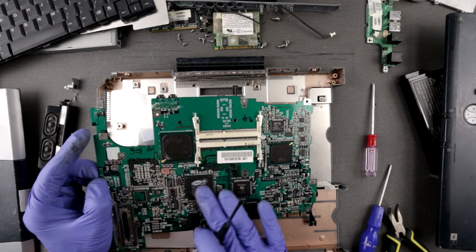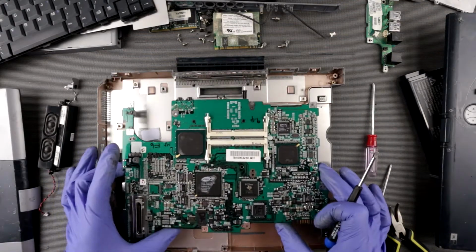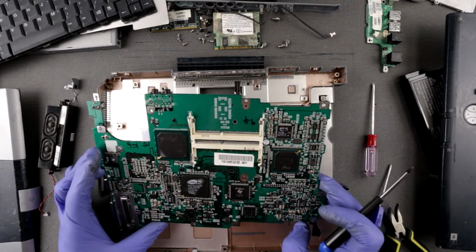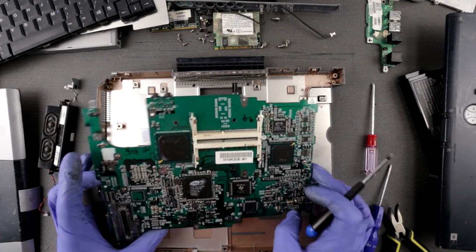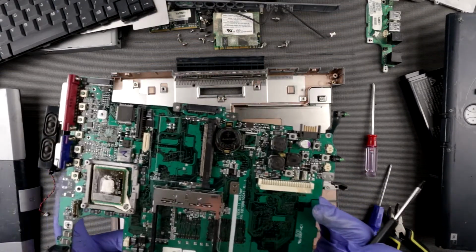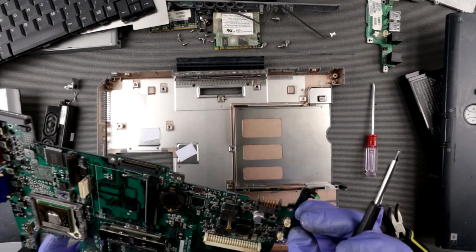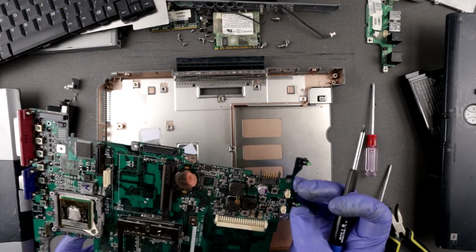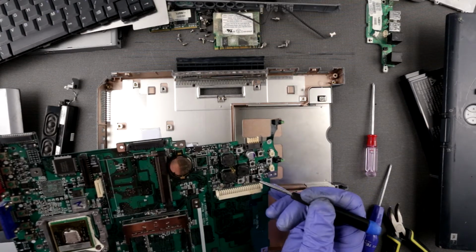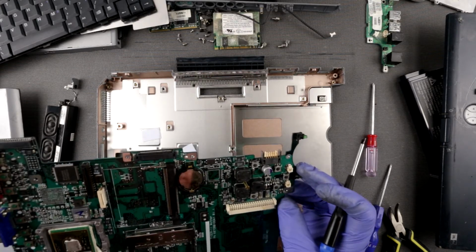Maybe for giggles I'm gonna take this video card, clean it up, use my rework air gun, and you can just pull this out of here. Maybe pull all of them, because I'm pretty sure, because of this corrosion on the power side over here, this capacitor leaked. I think this motherboard may be gone, and I'm not sure if it's even worth repairing it. By the way, someone did some repair already. There is some kind of flux residue over here.